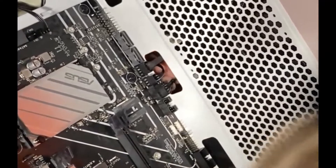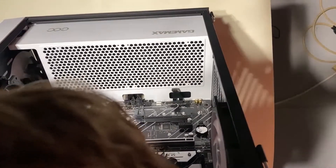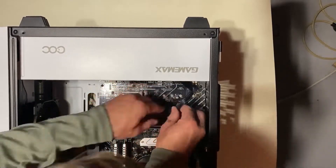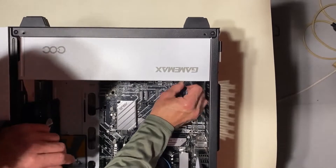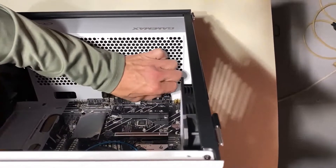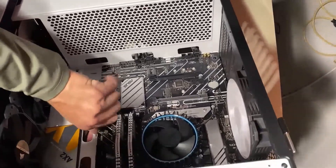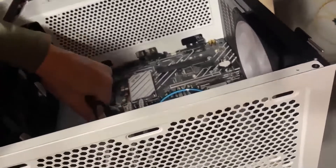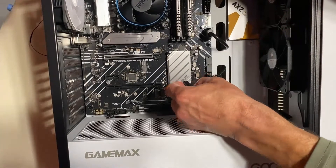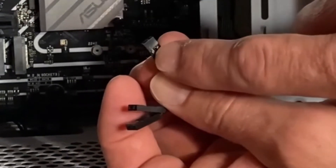The case I picked is perfect to match this motherboard. This motherboard only struggles with a 12700 if you don't have sufficient airflow, but this case has a 140mm fan directly behind the motherboard which actually drops the VRMs about 10 degrees. With this motherboard and case combo, the 12700 runs just as well as with any other motherboard — there's no drop in performance, the motherboard is not a bottleneck. On the back of the power button cables and HDD LED cables, there are little triangles that tell you which side is positive.